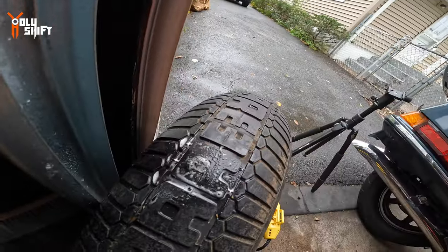The key message here: don't just get yourself a kit and have it sitting in your bags — actually practice. Do it once or twice until you feel comfortable. Find an old tire and practice so you won't be stranded at the side of the road in the middle of the night. Looks like it works — let it pressurize. I picked the kit up on Amazon; I'll have a link in the description. First time ever took me 15 minutes — try it out so you don't get stranded.